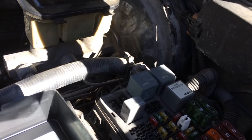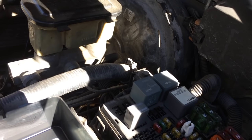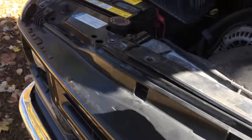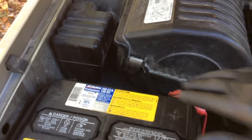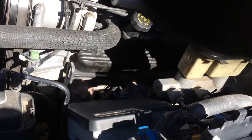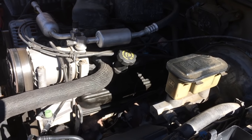With the relay out and the fuel cap open, you'll start the engine. Most cases it won't turn over. If it does, it'll be very brief while it runs the fuel out, and then you're done with that. After that, you're going to disconnect the negative connection off the battery because we're going to be doing some changes later. You'll see in the video where we change out the type of wiring harness used on the fuel pump module — it's a newer design since the one that was originally built into the vehicle.